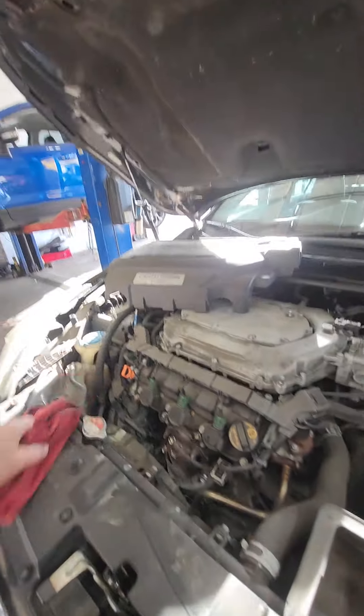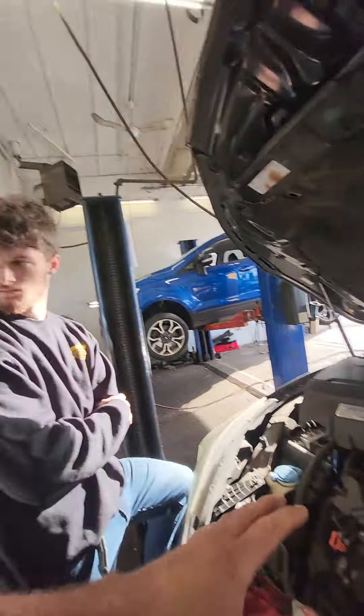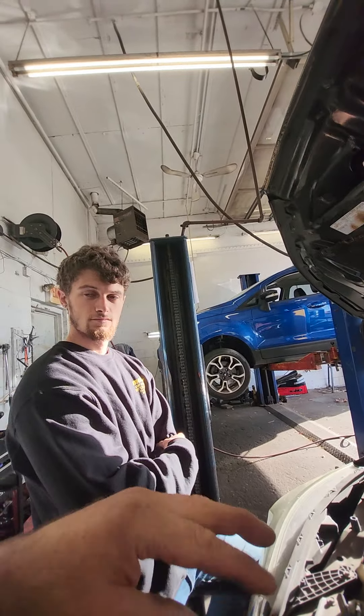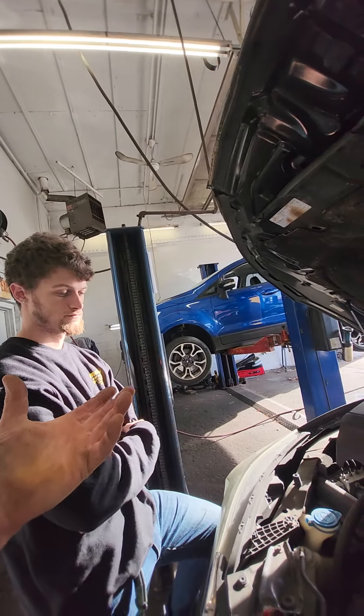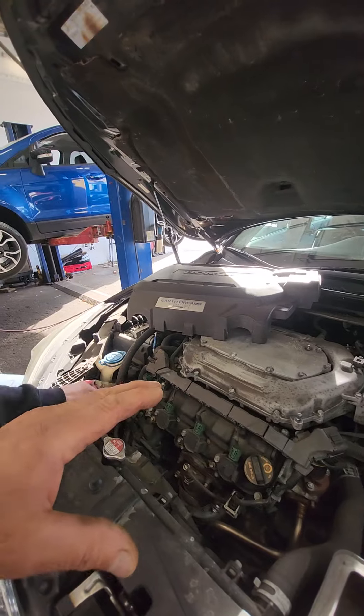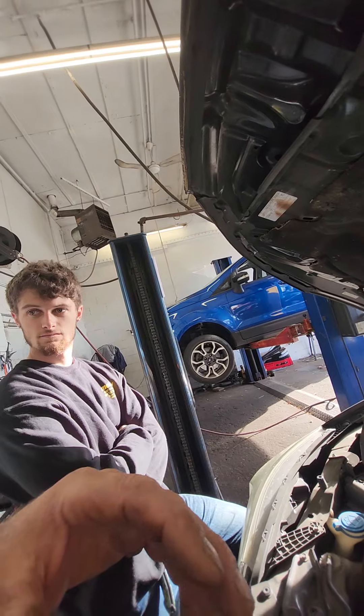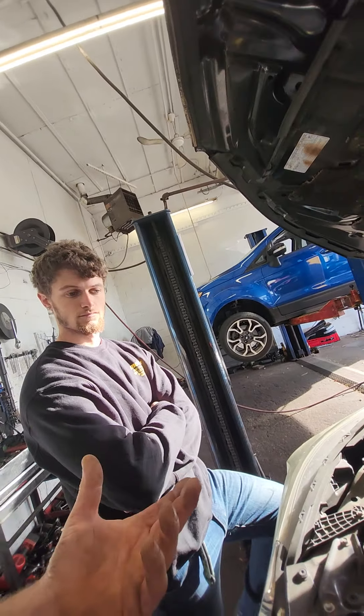I think they're just using our synthetic blend, but the color is very close in the spectrum. This engine is happy at 4,000 miles and full, which tells me you could probably go 5,000 miles — but I wouldn't, because you're in the perfect area where the oil is still able to remove contaminants inside the engine. It's not black, it's clean. You can't just say 'it's good' when it's black — your filter can't do its job.